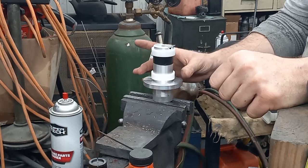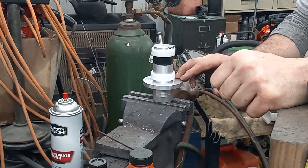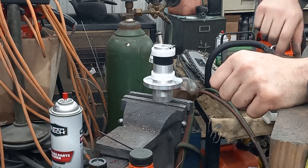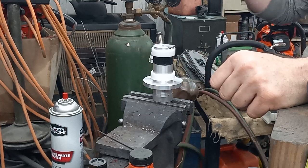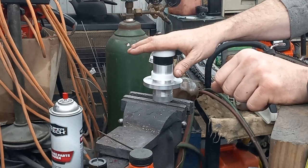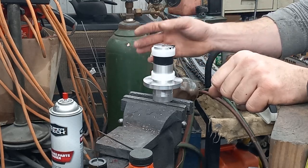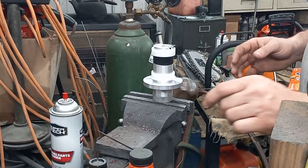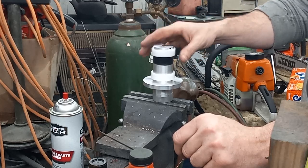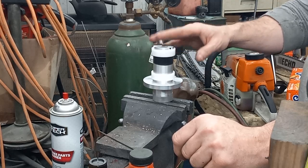I've seen a couple of people have something similar to this as a base stop. But a lot of the guys I know that cut with mandrels just slide their calipers in there, take a measurement, do a few turns, and keep going. I think this is a very safe option if you use it right — you got to know what you're doing. I've cut with mandrels before so I didn't test on a junk cylinder, but if you're going to start learning, I strongly recommend having some burned up junk cylinders to practice on first until you get the feel of it.